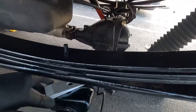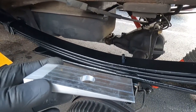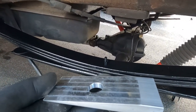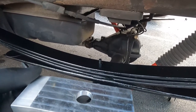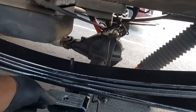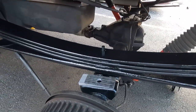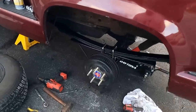But just so you know, when it comes to these wedges, if you want to raise the pinion angle, the bulky part will probably be to the back, and that would actually raise the pinion angle. But we are trying to lower the pinion angle, so having it on the front side is going to make the snout go down. So just going to get the hardware, get it in place, and start snugging up. Okay, so from here,